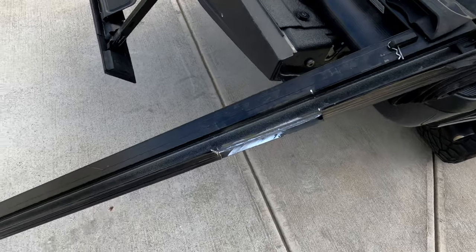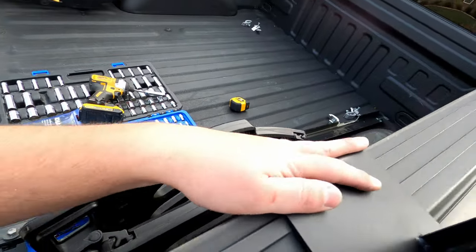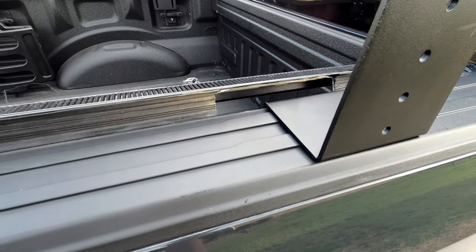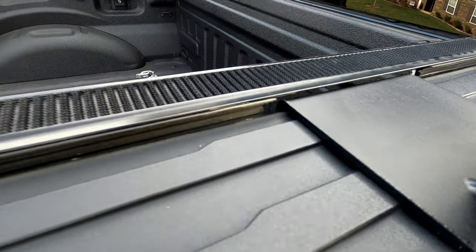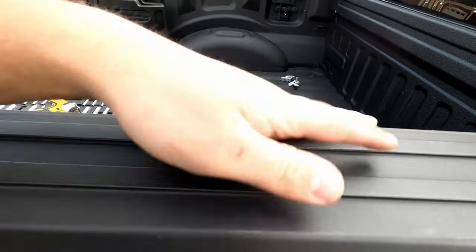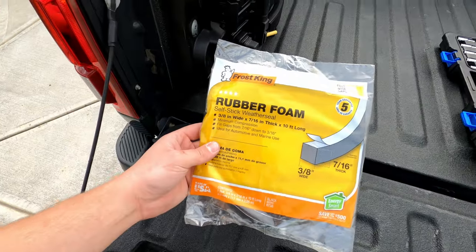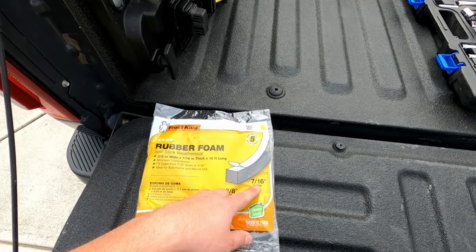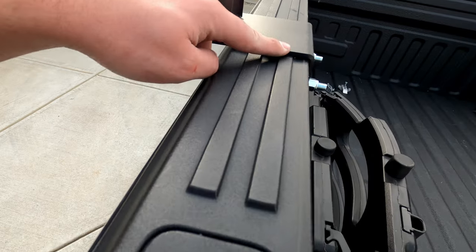We got the rails notched out — not the best job but it's kind of hard to get in there. I just used a grinder to cut this off. This is the space to clear right here. We're going to add some weather stripping in there. I'm applying a rubber foam self-sticking weather seal — 3/8-inch wide by 7/16-inch thick, which compresses down to 3/16-inch, about the thickness needed.